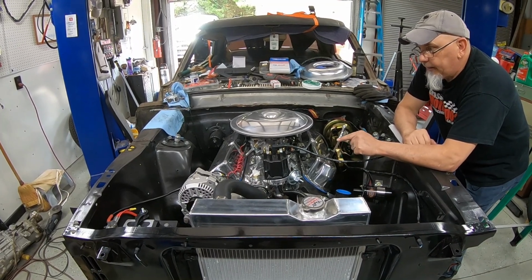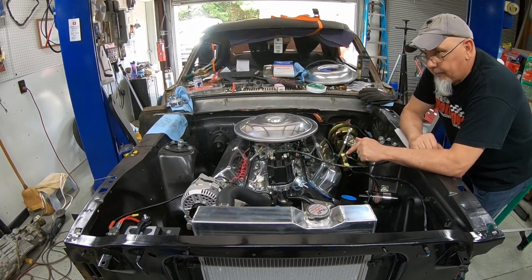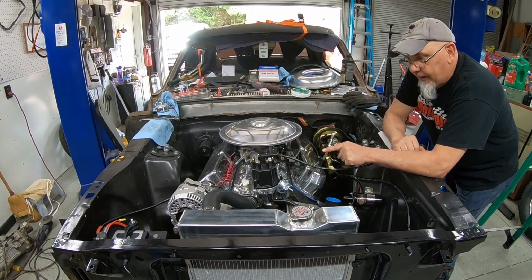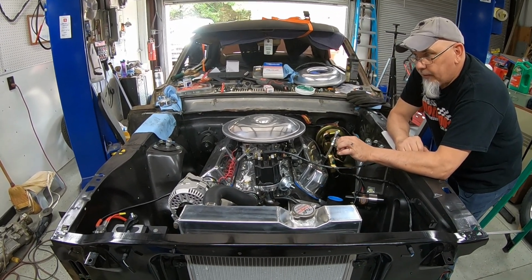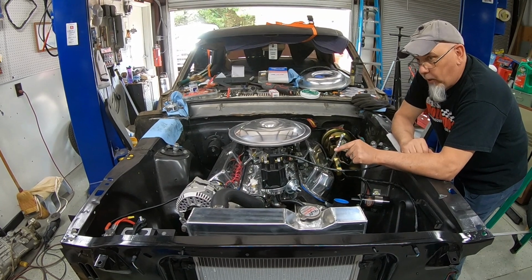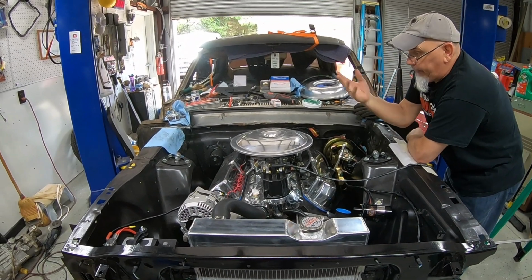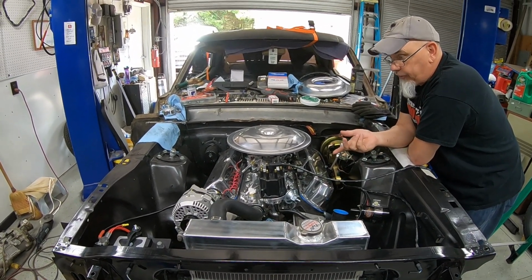And another thing that bothers me is that when I put the steering rack in, I kept noticing that when I would tighten one side up and then I would go to tighten the other side, it kind of moved everything. And then I put a protractor on the heads of the steering rack mounting bolts, the tubes that are welded into the K-member, and they are welded in 4 degrees different from one another. So you've got one bolt like this and one bolt like this, and that's why whenever I was tightening it up, it was twisting everything around. But they're in rubber bushings, so I don't really think it's gonna matter. But that just speaks to the quality of this kit, along with why the motor is sitting up high on one side.